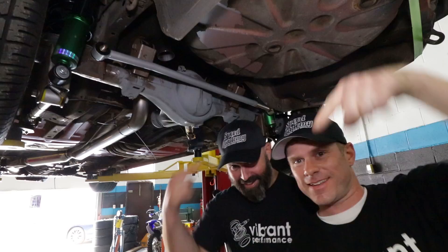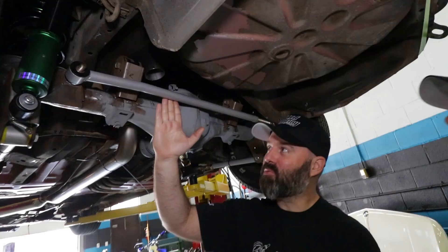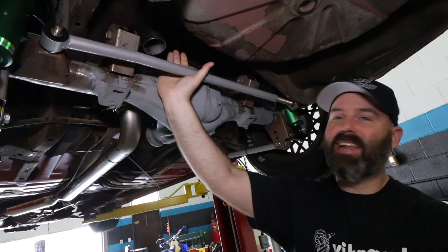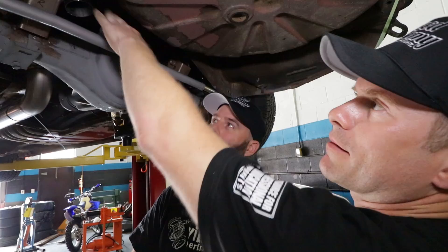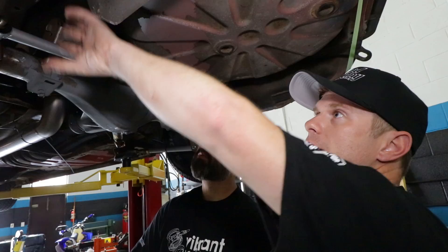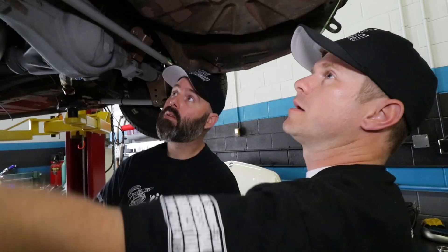The hats didn't make me any smarter — I didn't have the panhard bar on here. Jay had the exhaust routing going right into the space where the panhard bar now lives. So he's unfortunately going to have to make a cut, shorten that tube, and work around it into a bit of a tighter space. We're going to bring it out on a wider angle, closer to the spare tire well. We got over the axle with lots of space — still about three inches even when the car is fully compressed. We put it on the ground to check that and there was tons of clearance.